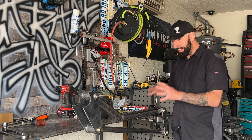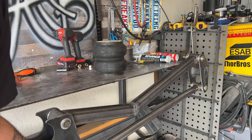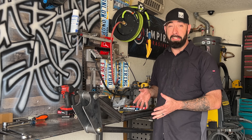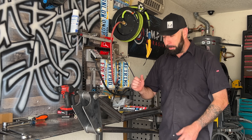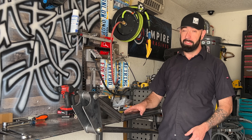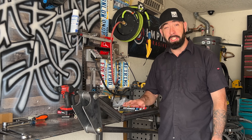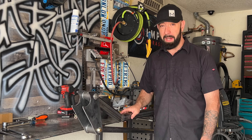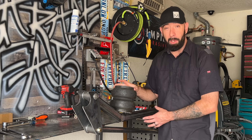I have the right side of the C10 4-link assembled on my bench so that I can see how everything looks and how it operates, and so far I'm really happy with it. It's far from done, but I'm getting nervous. This entire thing has been designed and built without the presence of the truck, so I honestly don't even know if this fits — everything was based off of measurements and cardboard. The square tubing was cut and welded at an angle so that it wouldn't contact Keith's compressor rack as it moves. I still want to create some fish plates and some support gussets underneath, but before I do that, I think I should bring this across town and make sure everything looks okay. Cutting off those fish plates and gussets will be a lot more work than just driving a few miles to the other side of the city. While I'm there, I want to see if I can determine where the air springs will be mounted so that I can build some brackets for that as well. This episode of Long Distance Fab will be continued.